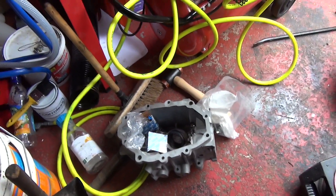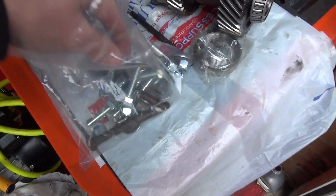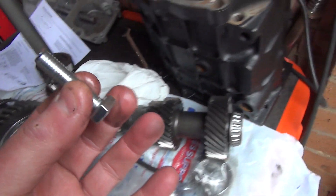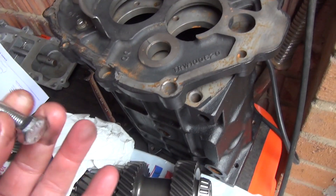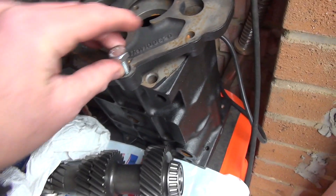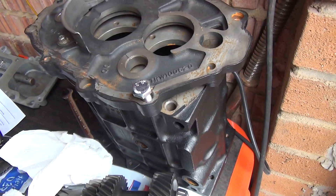I'm running out of things to do on it - hopefully in the next couple of days I can get this all back together and put back on the car. With the bell housing here I've got some new hardware - these are 40 millimeters long and you're going to need these as slave bolts when you come to do the end float. You can't use the normal bolts to pull these together. They're about 40mm long - you could probably get away with 35 as long as they're threaded all the way. These pass through and get bolted down to the extension so we can get the end float sorted out and get some shims in.